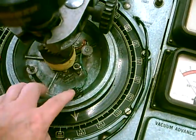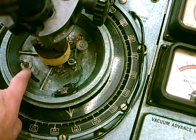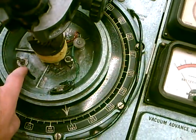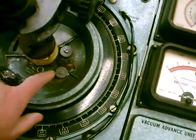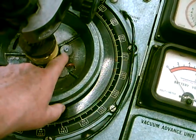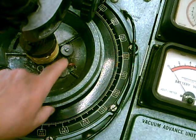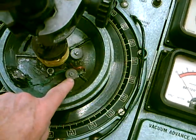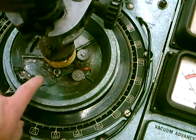This is the LED right here. This stack over here with this slide had a number of washers — about 8 or 9 washers. We reduced this down to 1 because the screw is captive and we need to have something there. Where the capacitor used to be, we put about 4 or 5 washers at the first mounting hole, and we have one washer and use this other connection here with the ground lug for the return of the LED.